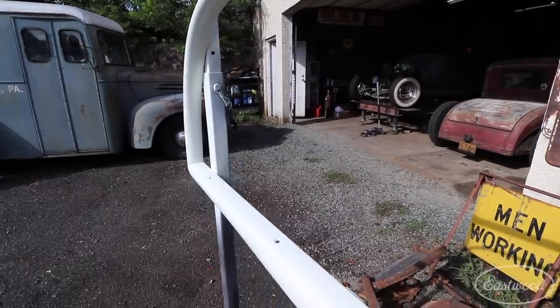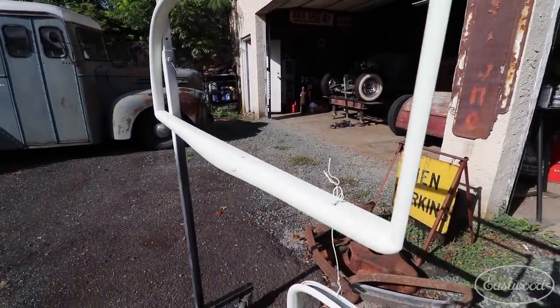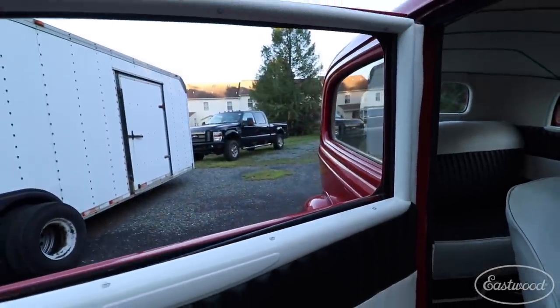After about 48 hours, I let the paint harden up and sit in my shop so everything was fully cured. When I was putting the garnish molding back on, I didn't have soft paint that I could put an indentation in or chip easily. This garnish molding is kind of difficult to put in — you have to clip it in different areas and put interior pieces behind and over it, and it's a bit of wrestling. If I'd thrown it in the next day, we could have had issues with paint cracking or deforming when tightening the screws. It went in really, really well and it looks awesome.